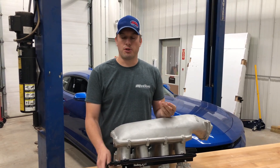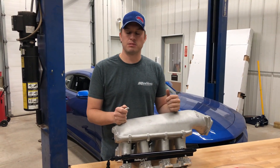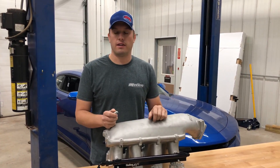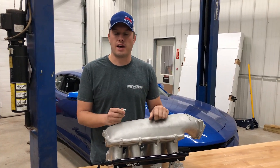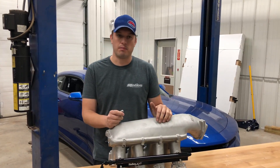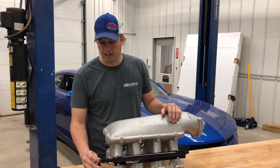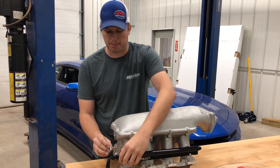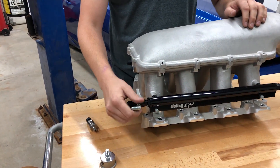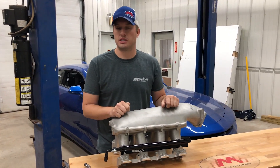Lastly, for methanol cars — a lot of people are going to cable drives and belt drive fuel pumps, and one of the only downsides is that some systems are hard to prime depending on your pump's relation to the tank, the length of line, and everything else. Some systems prime easily, but some people have difficulty, especially when you switch to pure methanol. A simple easy solution is to use a gauge adapter — you screw in a fitting and use a small 255 pump, either externally or in-tank, to prime the whole system.